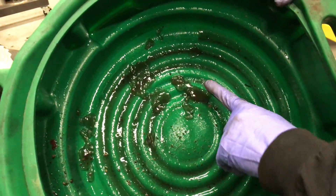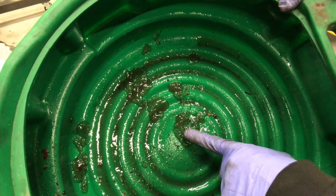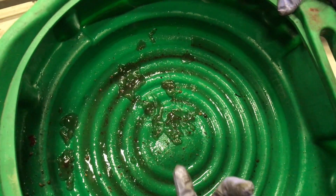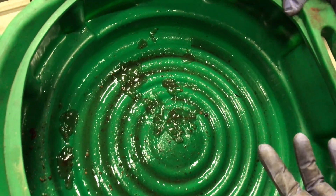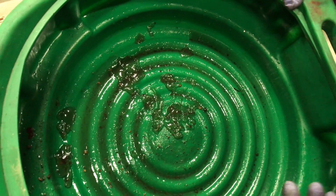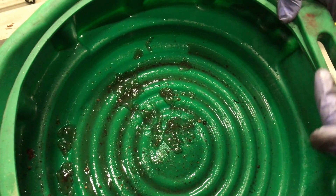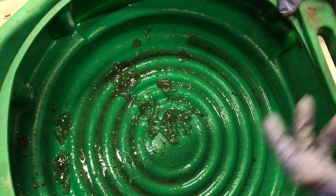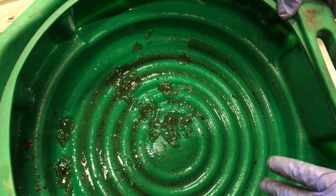You have all these little bits of jelly — a gelatinous blob-ish stuff that can clog the heater core, causing no heat or low heat. They can also clog different other small vent lines. So you only want to put pink coolant in.